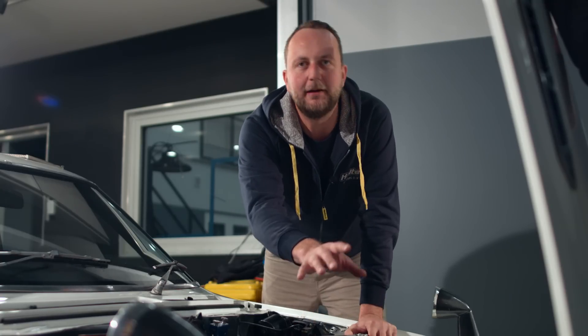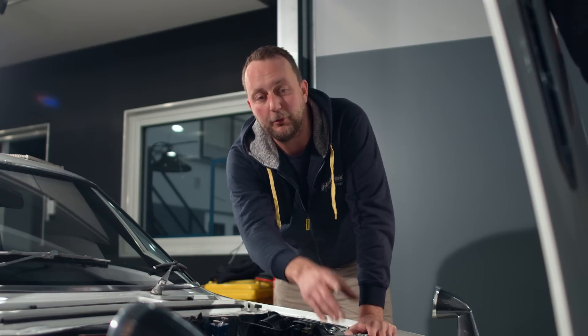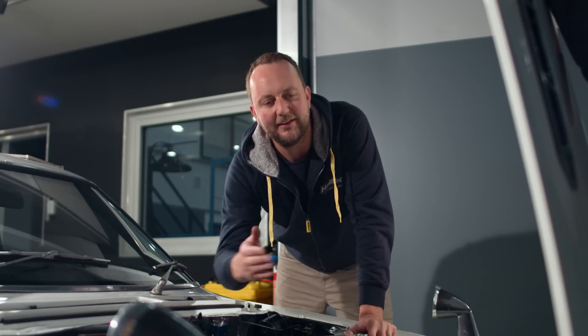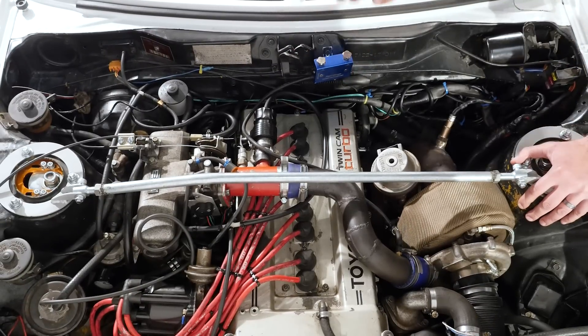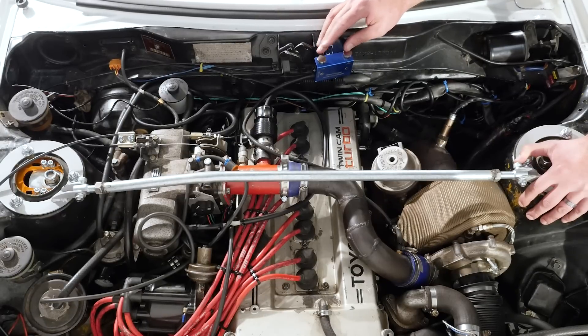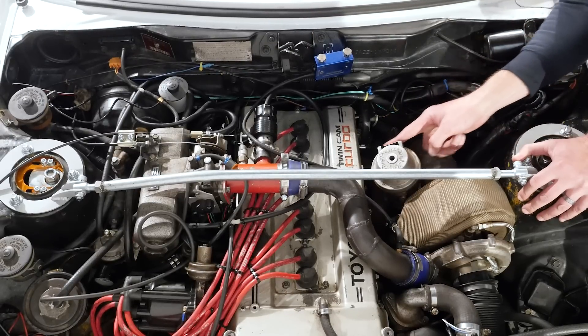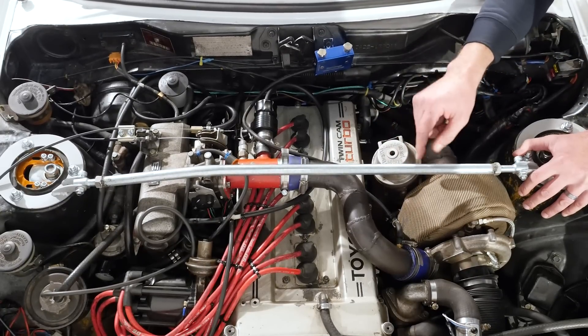Down in the corner of the engine bay is something pretty cool that I haven't seen for a while either. It's got an electronic thermofan controller which is all self-contained — it's got its own temperature sensor, a little digital display that tells you your coolant temp, a little relay base, and that's what turns the fan on and off. Nowadays we do it all through the engine management system, so there aren't so many modules all through the engine bay. Over here, something that's really not that period correct for this car is a Turbosmart dual stage boost controller. These were around in sort of the late 90s, with two individual stages and two pneumatic circuits to have two different boost levels. Written across the front of the wastegate it tells us it's got a five pound spring preloaded, and do not open under any circumstances.